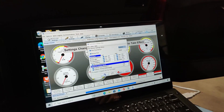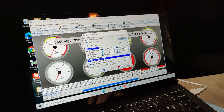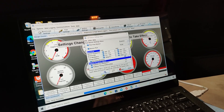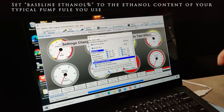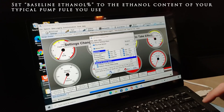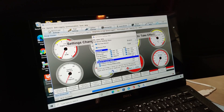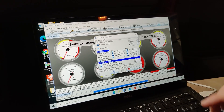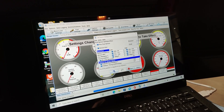The biggest thing we're going to have to change right here is the ethanol mix baseline. Most gasoline in North America has 8 to 10% ethanol content. So when you fill up at any gas station like Texaco or Chevron, it's going to have about 8%. We want to give an 8% baseline so it doesn't change your fuel table — that just means the gas in your tank right now won't modify the fuel settings in any way. For additional timing for E85, we're going to zero that out and make sure all timing and ignition changes are zeroed out. Make sure that's good and hit burn.